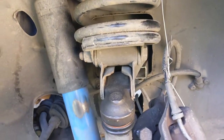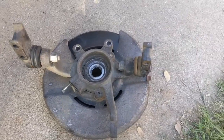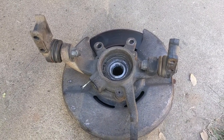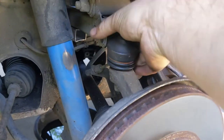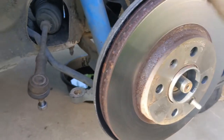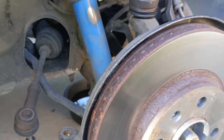I'm going to take the steering knuckle off entirely — those four bolts — and then withdraw the whole thing, which looks like this when it's done. The reason I do this is to get it out of the way entirely. What Saab asks you to do is just take the top off and rock the steering knuckle out, which allows you to disengage the axle from the transmission.